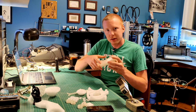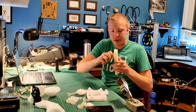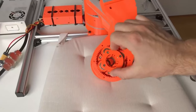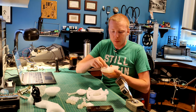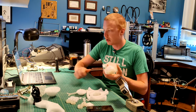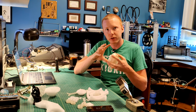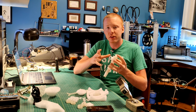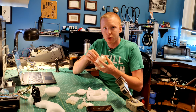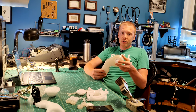I recently printed the planetary gear assembly from Skyintific's robotic arm design — it's from the motor drive portion of the arm's movement. This planetary gear assembly gives about a five-to-one gear-down ratio, and I think if I scale up this design big enough, I can put it on the axle of the four-wheeler to get more torque, less speed, and be able to haul an adult more easily.